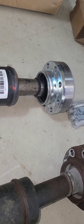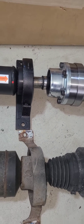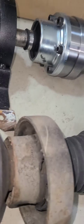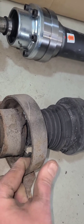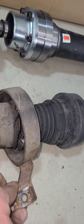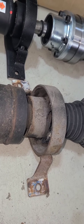You've got nice captured field bearings in there, you've got nicer strap clamps than the factory one, and it even came with brand new hardware on both sides. The center joint here on these two-piece drive shafts really impressed me. What fails on the factory one is it's got this hockey puck bushing in here holding that bearing, and it just turns into a mess. The car has about a hundred thousand miles on it — why you'd expect a rubber bushing like that to capture a bearing and not fail over time, but you can see it's pretty chintzy.